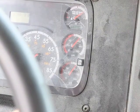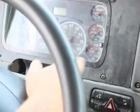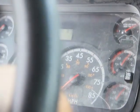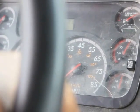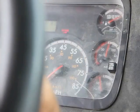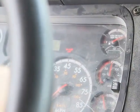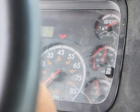It means I'm good. The next test, I'm going to test my light and my alarm at between 90 and 60 psi. I want to make sure my light and or my alarm comes on to let me know that I have a leak and I'm getting down to critical air pressure. So I'll fan my brakes, meaning I'll push my brake pedal up and down. And right around 60 psi, right about here, if you'll notice, you got a low air warning light, also an audible alarm that sounds when you're starting to reach the critical level, which is between 60 and 90 psi on your gauges.